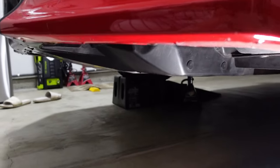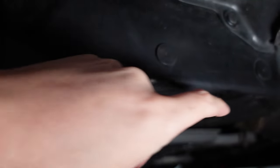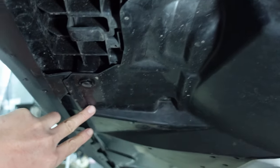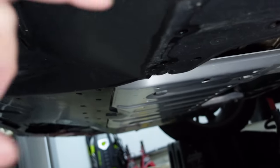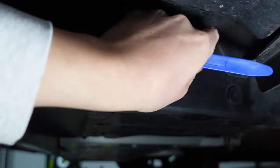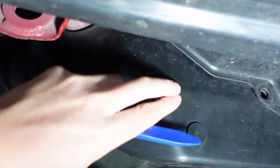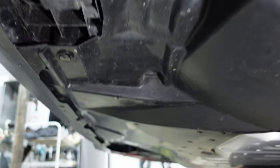I'm going to try to get the best angle here possible, but it's a little hard with it being under the car. What we want to do is get this entire piece off — it's one big piece that goes all the way along the front of the car that we want to remove. It's kind of a U shape. So we just want to get a simple prying tool or a flathead screwdriver and take off each clip until this piece comes off. Let's go ahead and do that and move on to the next step.